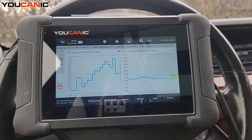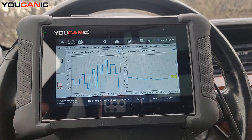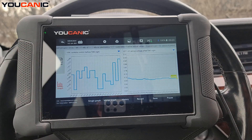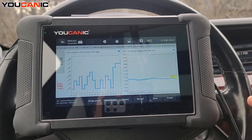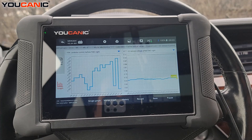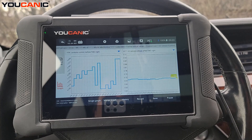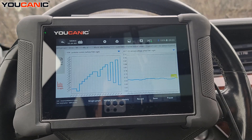As mentioned earlier, if you're seeing fluctuations downstream or an extremely low value like 0.1 or 0.2, there's a possibility the oxygen sensor itself is defective — that's where it gets tricky. For the upstream, you want to see lots of fluctuations between 0.5 and about 1 volt with values changing rapidly. For the downstream, you want to see a steady reading between 0.5 and 0.7 volts — that's ideal for a healthy catalytic converter.